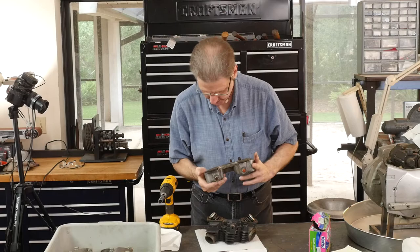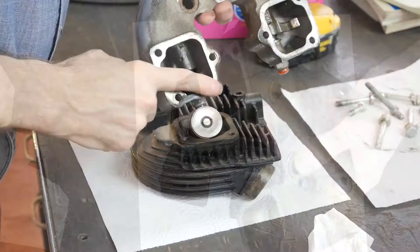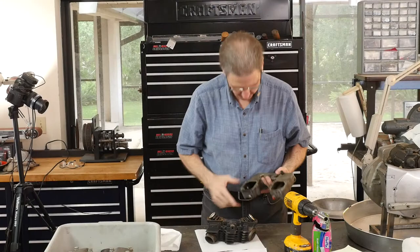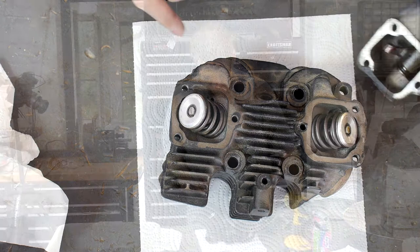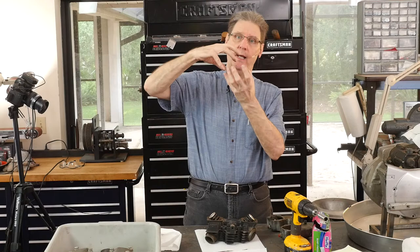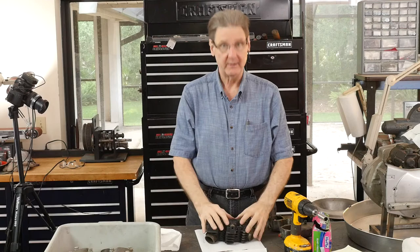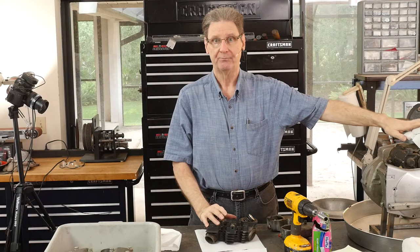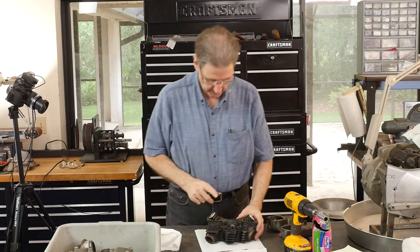Like I suspected, it's pretty much brand new, although not ready to go. Something went wrong with this and this gasket doesn't match. The valve everything here is new — you can see a little overspray, brand new collars, brand new springs. The best diagnosing I ever did: driving down San Carlos Boulevard, it felt like a bump in my butt. It was the outer spring had broken and occasionally it would rotate and coil bind — bang, bang. I actually could feel it. The rear head, you can't get the box off, so I got the head off and was pleased to see I caught it in time — the inner spring was fine because I don't rev the bike.